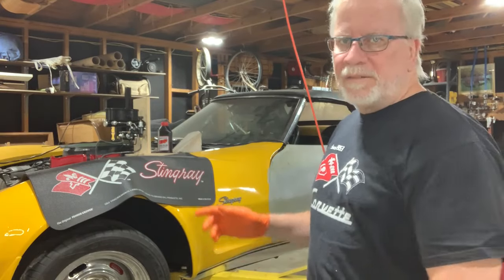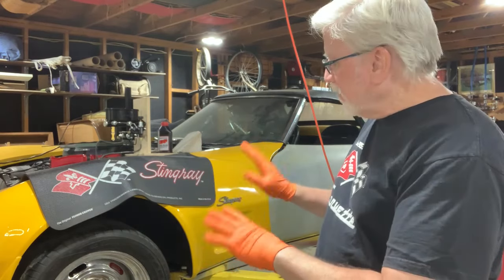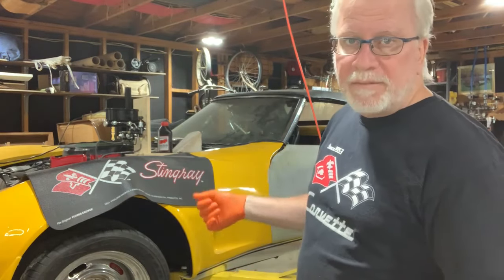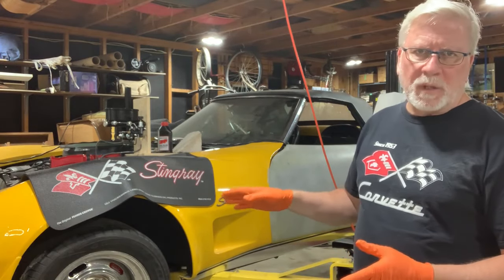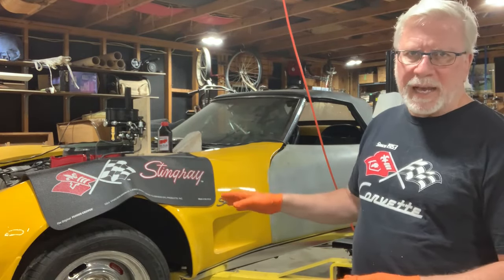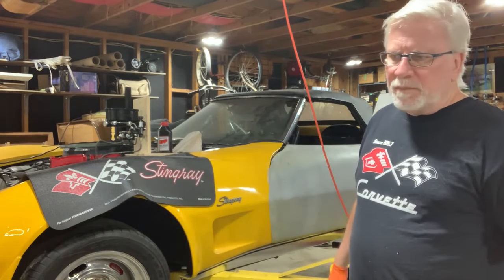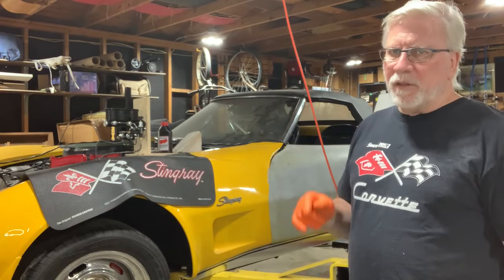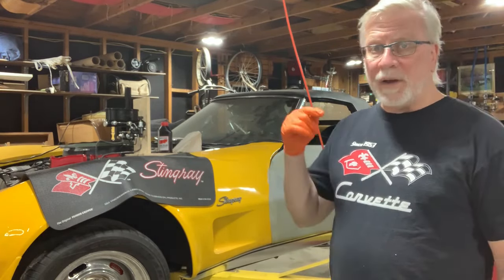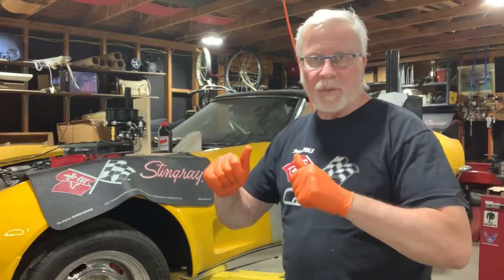Right where we left off. We're gonna get this master cylinder on here, but first I'm going to get the wheels off of it, and I wanna disconnect all my new flexible hoses, my new flexible lines off of this thing before I go running the new brake fluid through. I wanna flush out all of that old brake fluid first, and I don't wanna run it through my new calipers. So I'm gonna disconnect all of those. So let's do the title intro and we'll hit it.